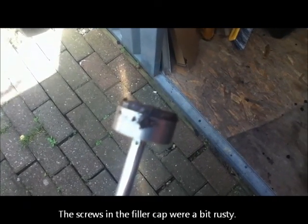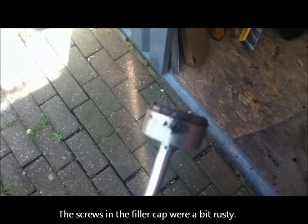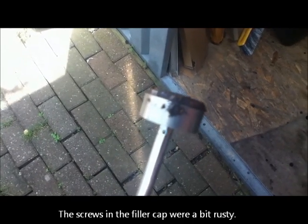I put my magnet on a stick into the crud that's in the tank, and as you can see, quite a lot of it is stuck to the magnet, which means it's actually rust. Well, none of the components inside can really rust, so they've either come from the fuel or from failing fixings. I'm not really sure where from, but I'm definitely going to get that all out.